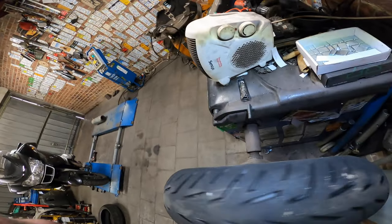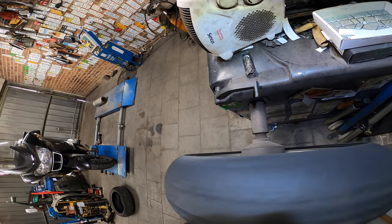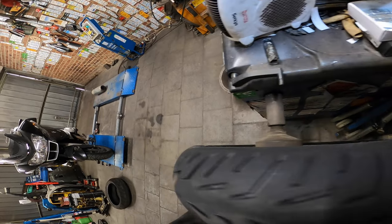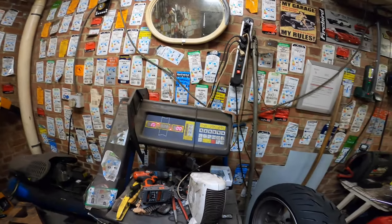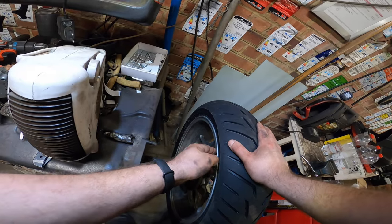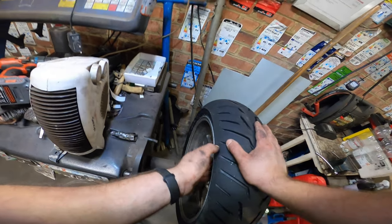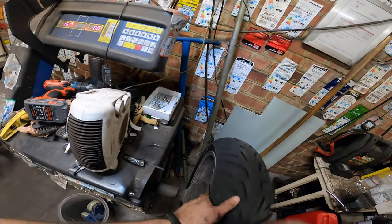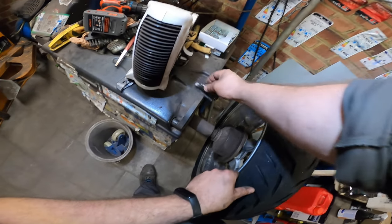Let's go for a spin. Yeah, spins nice. The rim is okay. 15 grams to add extra. So the machine is now holding account for a rim where you put on the weights over here. We were gonna put them over here, but it's more or less the same. So 15 grams. That's right over here.